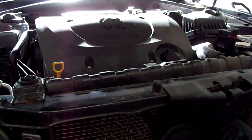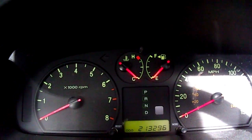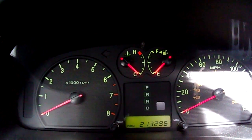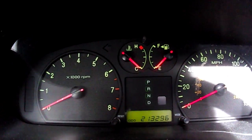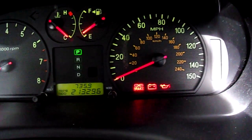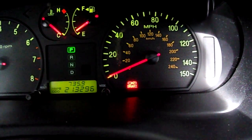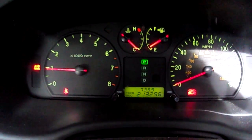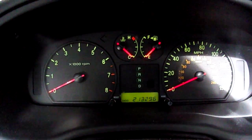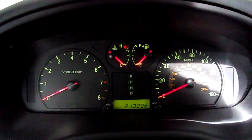Now that the bottom is taken care of, I have the oil cap back on — let's go start it up. When we start it up, we're going to find our oil light. When we first start it up, the oil light might come on for a second. Now we know that the oil light is off. If we have an oil pressure gauge, that will work as well. I'm going to turn it off, and now we're going to check the engine before we run it for any extended period of time.